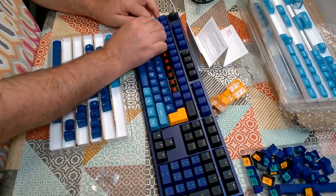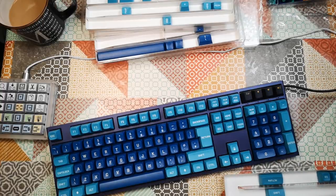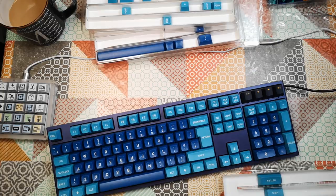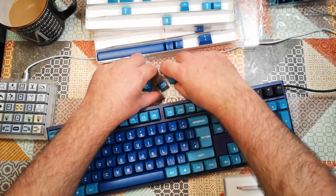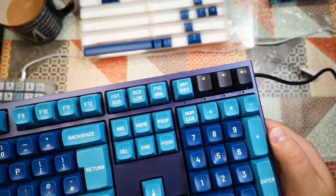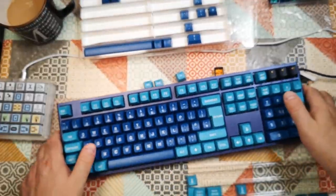And on go the keycaps, and they really look superb. But there's one more problem. The Ducky keyboard has four extra keys that are not part of the standard ISO layout. These extra keys launch the calculator and control the system audio. The MT3 keycap set contains quite a few spares and blank keycaps, but you can't just use any key — these extra four keys are on row zero, and need keycaps sculpted for row zero. There are none of these spare in the pack.